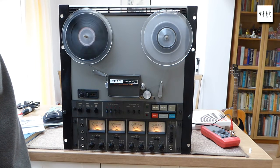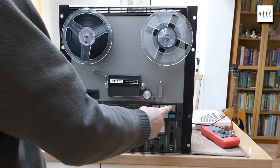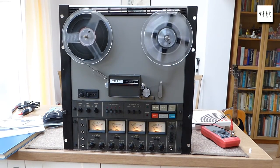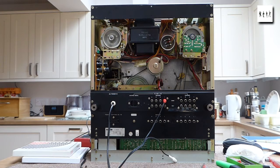The mechanics now seem to work OK, didn't have any problem with those. The belt swap was very quick. The capstan is now cleaned — it was pretty grubby before but it's OK. And the pinch wheel looks fine actually, given its age.